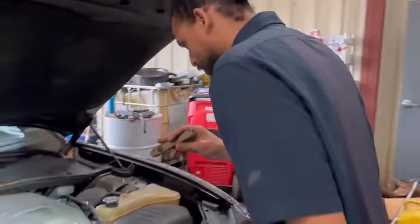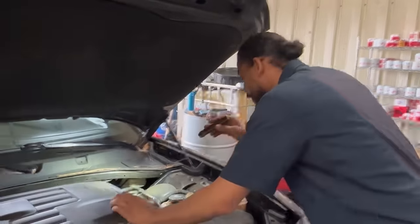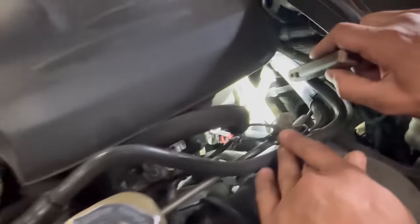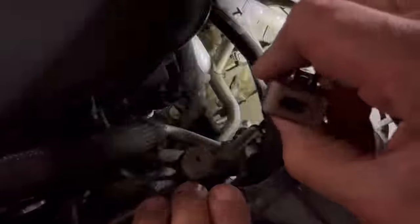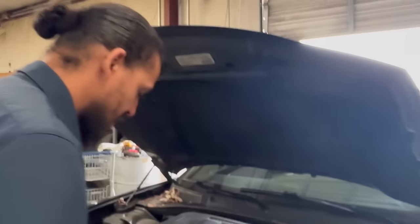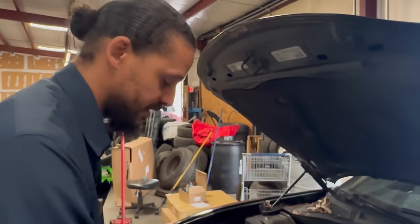So motor mounts, oil cooler — the norm. And this oil cooler is leaking pretty bad because it's starting to leak down behind the transmission. The transmission looks kind of oily. You might not be able to see it through there, but it's got oil all over it. This oil cooler does not have long before it ruptures. I definitely need to make sure the customer knows about that before it leaves them on the side of the road.